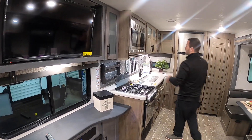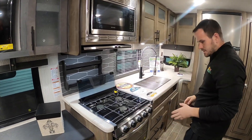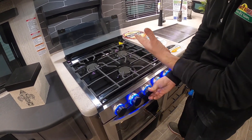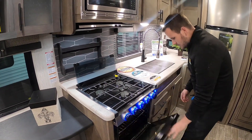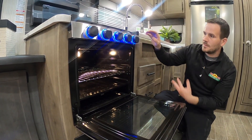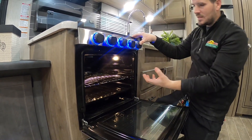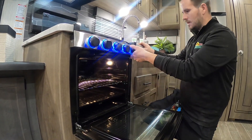Plenty of storage down there. You have your standard range microwave — pretty easy to operate, standard just like any house microwave. These new cooktop stoves are pretty nice. If we had LP I'd show you how it lights, but basically you turn it to high, hold it in, and you have your clicker over here — hold the button in and turn it a few times until it ignites. Sometimes it takes a little while if the gas hasn't reached its way up here. The ovens on this style of stove have igniters. Turn it to the flame, hold the button in, give it a few clicks until you see a little flame at the very back, hold the button in for a few more seconds, let off, turn it to whatever temperature you like, and that will ignite the whole bar in a flame.